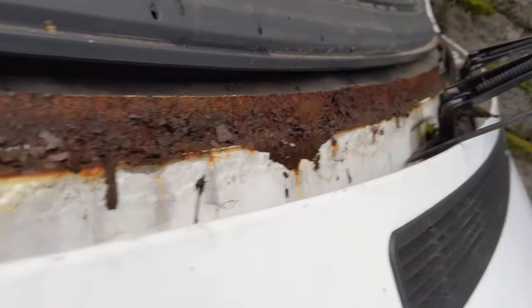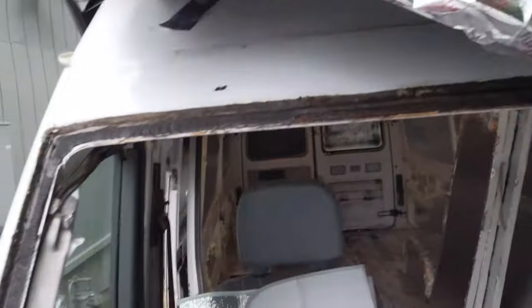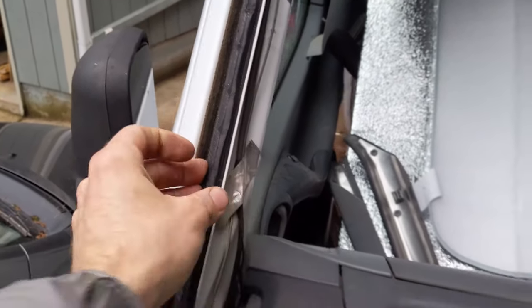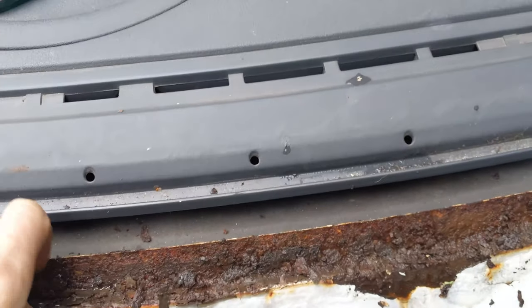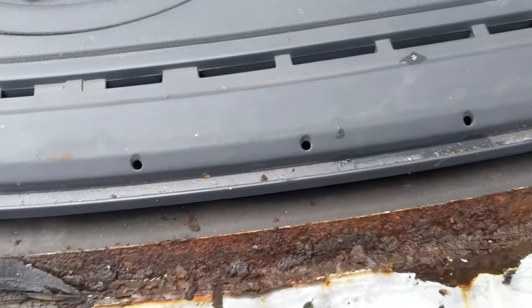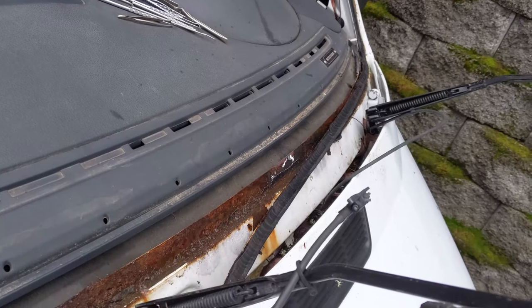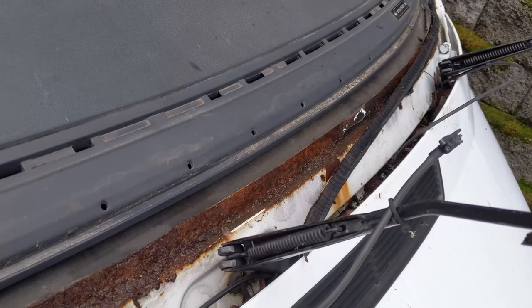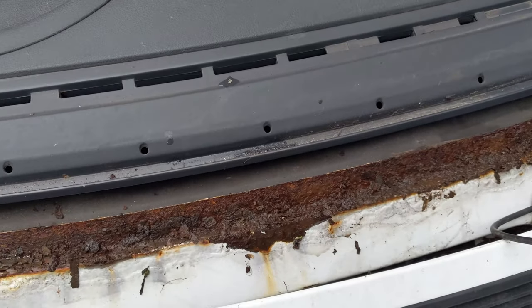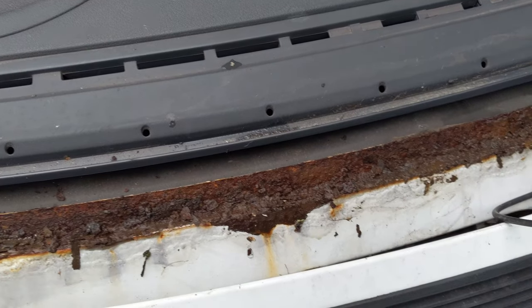Here's why we had to pull the windshield — it was not sealed at all down here, and up here it's the same thing. You can see all along there it was just leaking right in. So I'm gonna have to scrape and clean all this off, grind down all this rust to bare metal, apply some rust inhibitor, then epoxy primer, then some oil-based paint — put some real good paint in there and make sure it doesn't happen again.